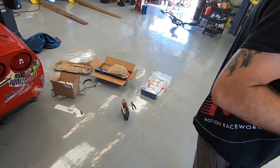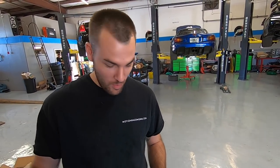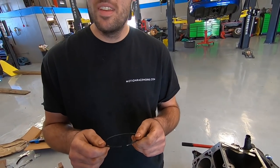Give her a test run. See, you count the taps for the first one. We're probably gonna do this about five times back and forth with this first ring, but I count the taps. And then you go back in the next one, you go one less tap. And then you check it. And if it's tight, then you go one more tap and you're good.